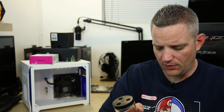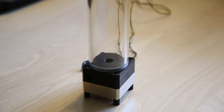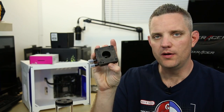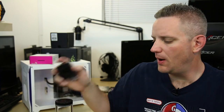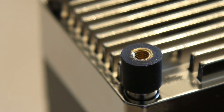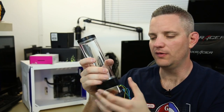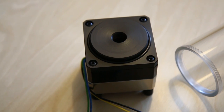The people who've done this before me have figured out that that makes the most sense. The assembly on this thing is extremely easy. The pump is contained inside just this plastic housing — it's just a clamshell that goes around the pump itself. We've got the pump inside the heatsink down here. These pumps actually get pretty damn hot, so there's a heatsink and even a thermal pad on there so the heat can be radiated out of the bottom rather than dumping all that heat inside the loop. We've got the Bitspower top here for the Laing DDC, and then the 150mm reservoir mount for the top.